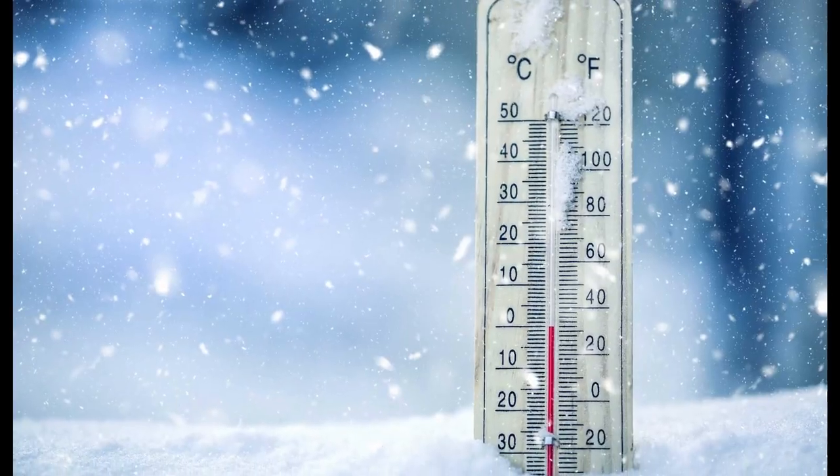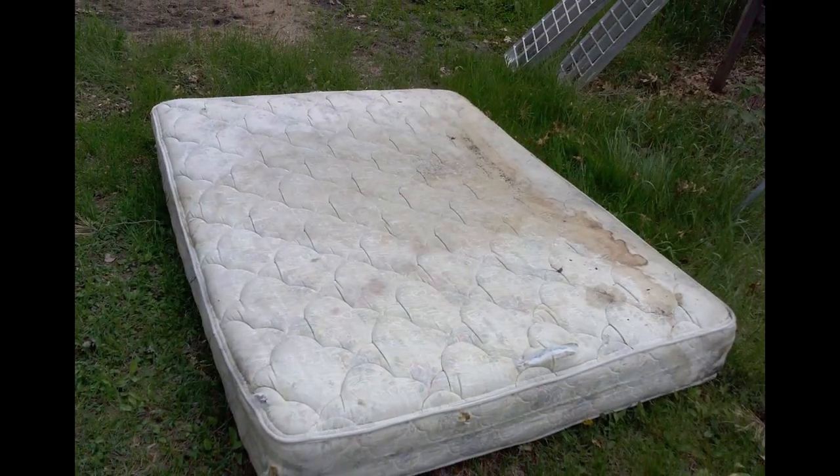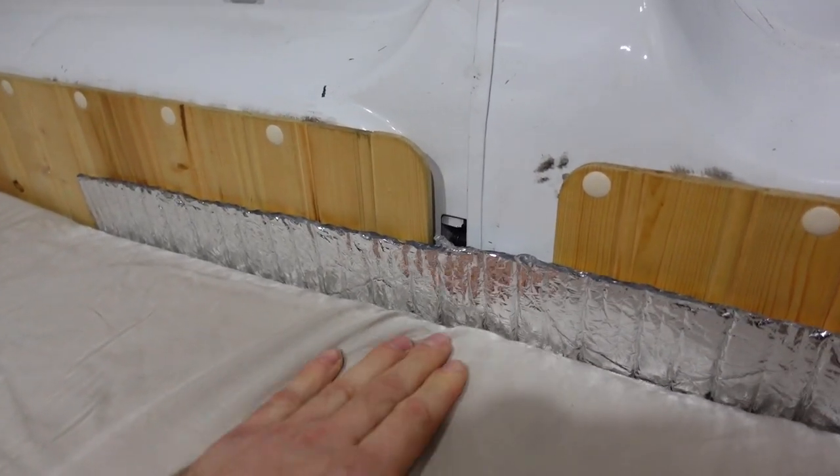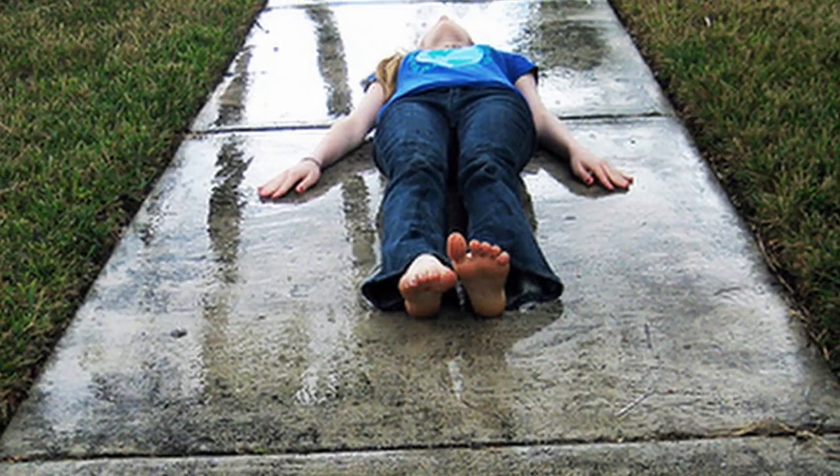The second issue also has to do with moisture. In the colder months the metal parts inside the doors develop condensation because the inside of the van is warmer than the outside. When there's condensation buildup on the metal it creates water droplets, and with the bed directly up against those metal parts that water transfers into the bed and can create water damage or even mold if left unchecked. In the interim, I put a piece of Reflectix as a barrier between the metal and the bed to stop moisture transfer. Both issues were easily avoidable had I not put the bed directly up against the back doors — I would have put a barrier on the back of the bed to maintain a small gap.